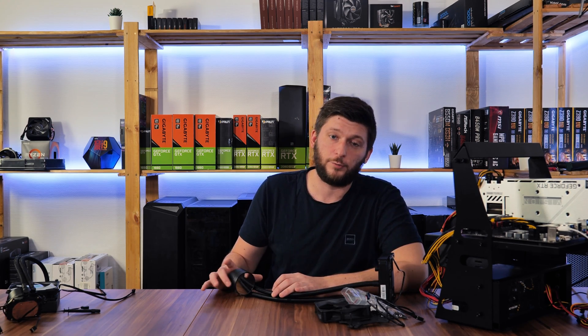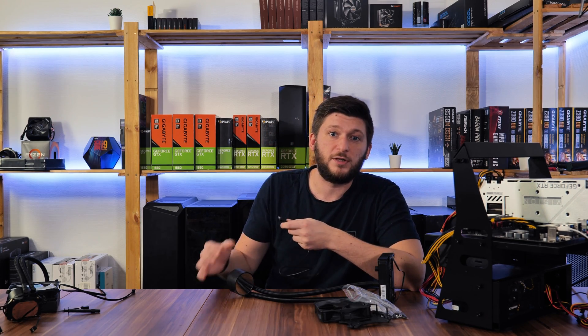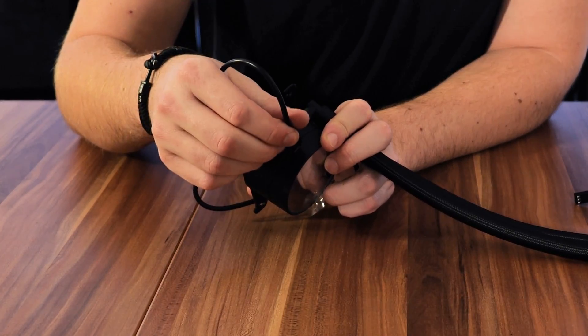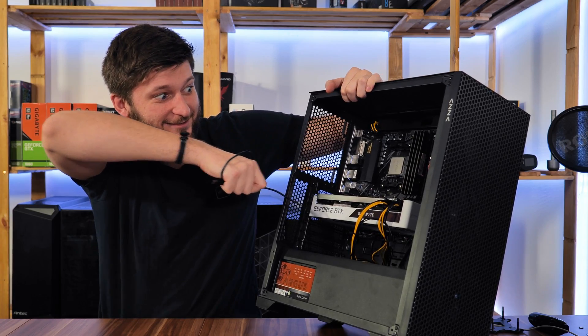Two things I really wanted to mention. First, if you have trouble getting the CAM software to recognize the RGB mirror, simply remove and reattach the USB cable on the water block while the PC is running — a bit like removing and reinstalling a USB drive. That fixed it for me. But please, do not rip out the USB header on the motherboard. Second, because the water block gets power from a USB 2.0 port, there is a strong possibility it will be always on, since USB headers usually carry some power even when the PC is off — though some motherboards do cut that power.